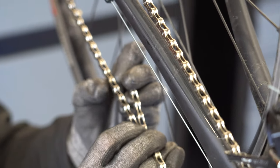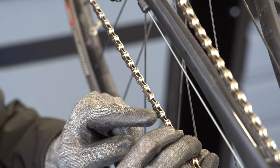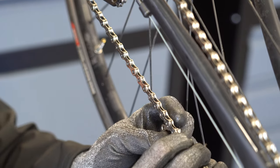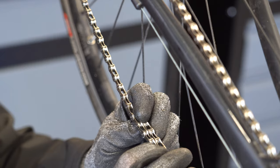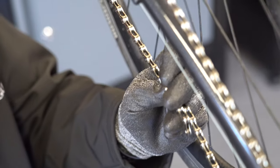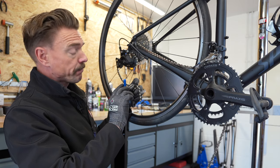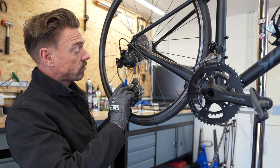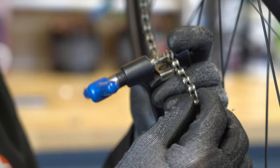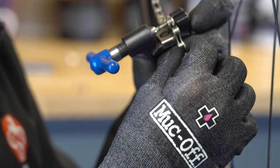With a little bit of tension in the system, I determine where I want to make the join — and I'm going to tell you right now that it's there. I'm going to take one, two, three pieces out of this chain like that and join it there. You can see I'm lining up the two pieces of chain over the top of each other. There's a little bit of tension in that derailleur even in small-small. I've decided I'm taking it back by three — one, two, three complete links made of an outer and an inner.